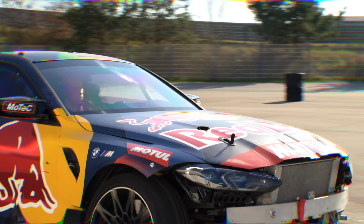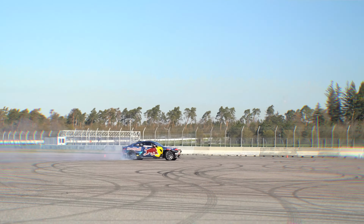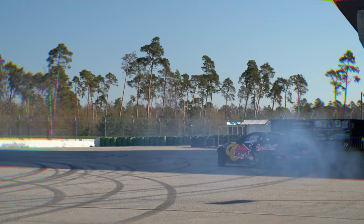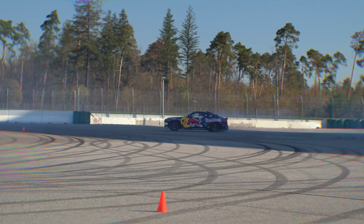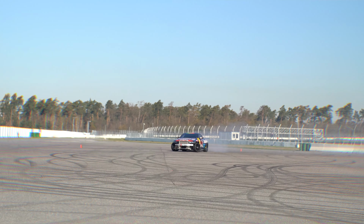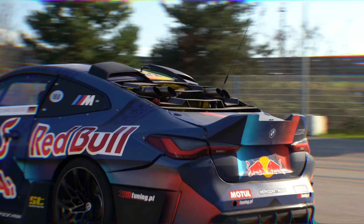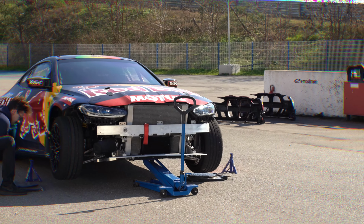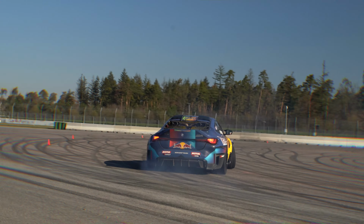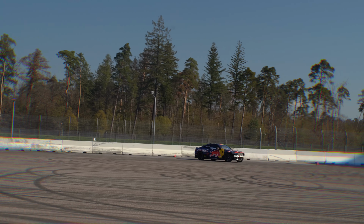And we took off for the next time with our cars. As said, we are very, very conscious about all the senses that you have. So you always listen to everything. And the smell, especially for fluids, is the most vital sense, because it can really tell you if there's something leaking. Each and every fluid has a distinguished smell. For example, coolant, if you have some additives inside, you can smell them. Or if it's oil or if it's brake fluid, it also has some distinguished smell. So this is very important.